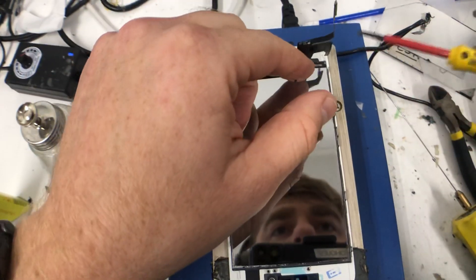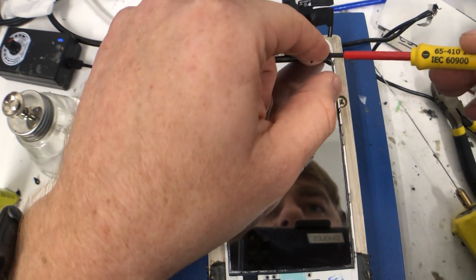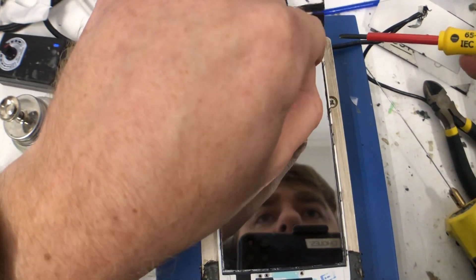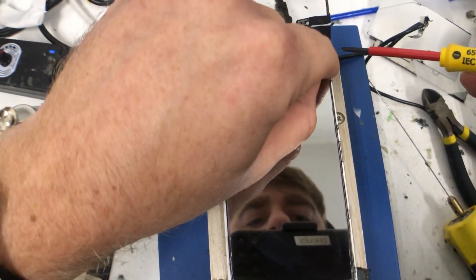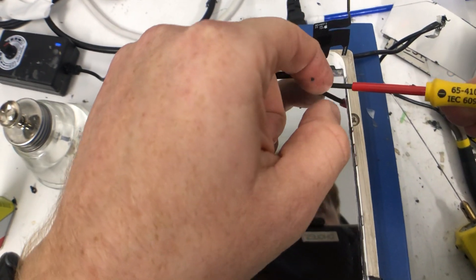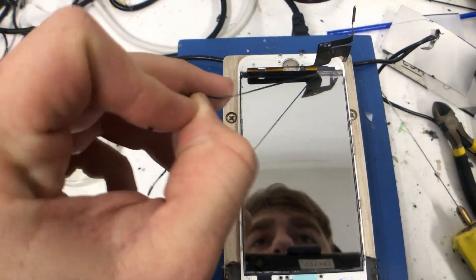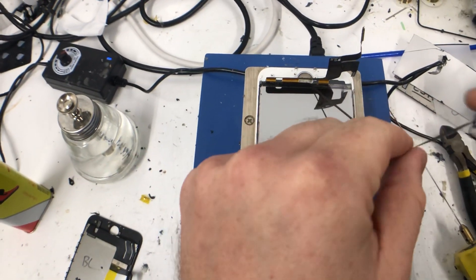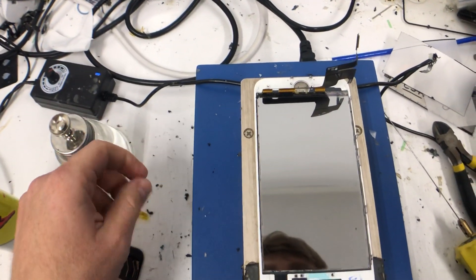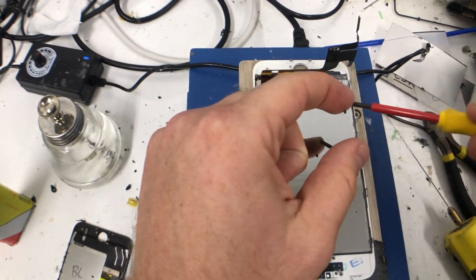It's just so much easier with my little scalpel. At the top here this black adhesive has the light grey thicker stuff — I try and pull that first because it comes off independently. Up here is the flex cable for the display — that's very, very delicate. It should double back on itself like the iPhone battery. If you damage that flex anywhere at the top or in the corners, you're going to get touch issues and display issues.